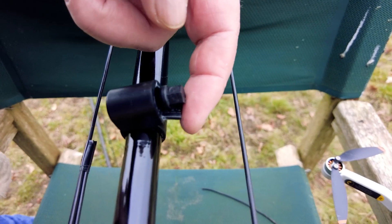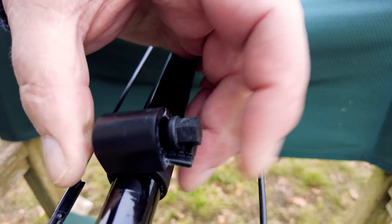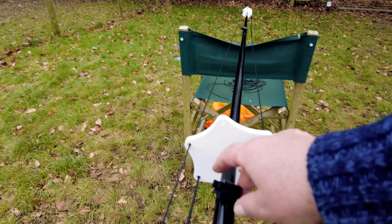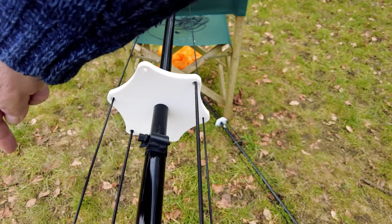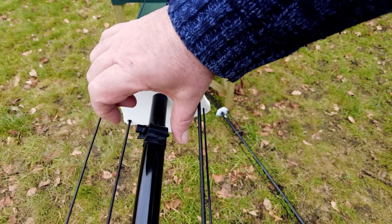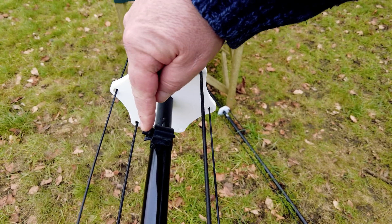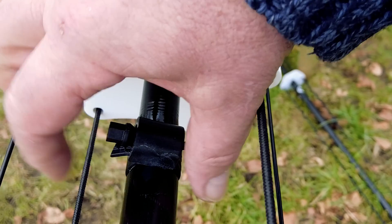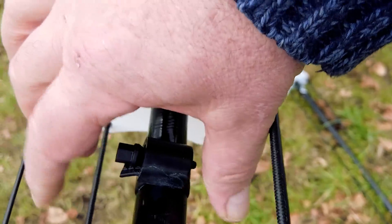Be quite aggressive when you cut the tails off the clamps — don't faff about. Whatever you do, don't fit them with the big long tails; it'll take you forever. Make a rough guesstimate, cut it short, shove it in. Use an 8 mm spanner — I used a box spanner here to close it off. You can be quite aggressive for a tight fit.